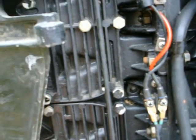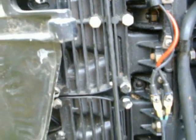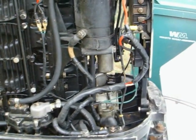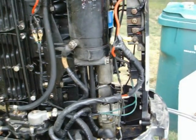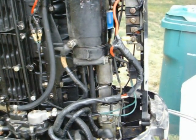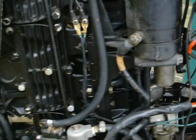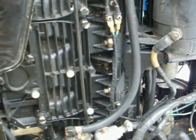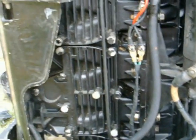Underneath the flywheel is the stator, which these two wires connect to. I had already pulled these covers off, which will give you a good look inside at the piston rings. To me it looks like one and three are stuck. Before you do any disassembly — and I know I'll have to rebuild the carburetors — your best bet when you start undoing things is to label these wires. I got some masking tape and I'm going to label those.